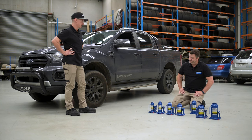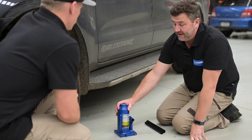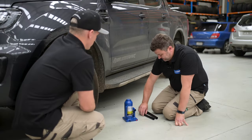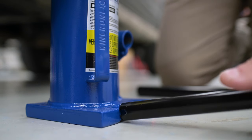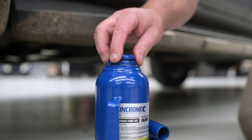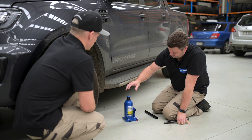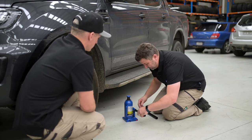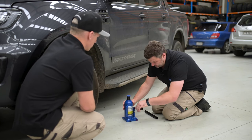So do you want me to show you how to use it? Absolutely. Okay. This is straight out of the box mate — very simple to set up. With the handle, all you're gonna do is make sure that the air valve is closed, so you turn it clockwise till it stops, and then I can adjust my screw height adjustment. I'll do that before I start lifting the vehicle, get it to the right height, and now I'm ready to start. All I need to do is put the arm into the pump and start lifting the hydraulic ram.